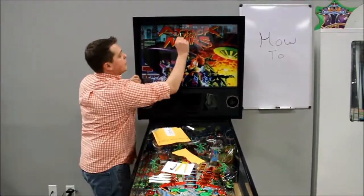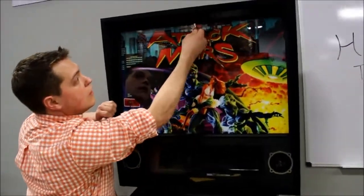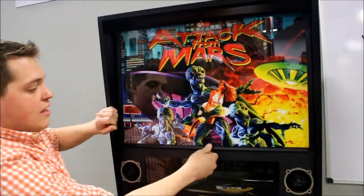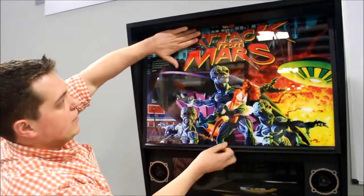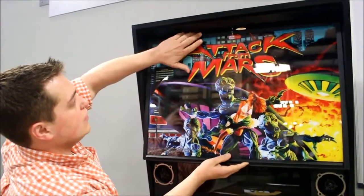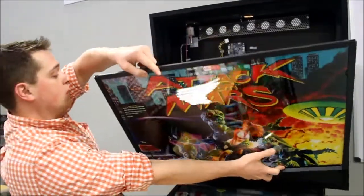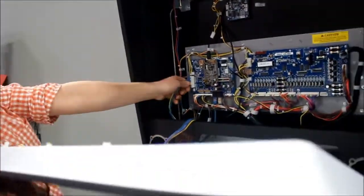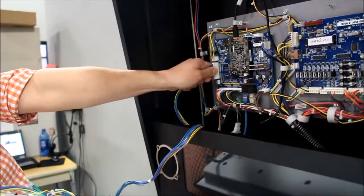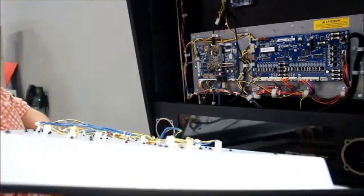You can go up here, place the key in the lock, and then lifting the bottom and supporting the top, pull the bottom out, drop it slowly into your hand, and then carefully — don't bring it out too far because you're going to need to remove this cord. It's plugged in right there, so grasp it firmly and pull it out, and then place it somewhere where it won't get scratched.